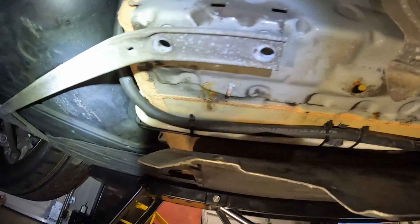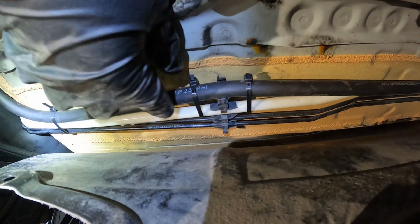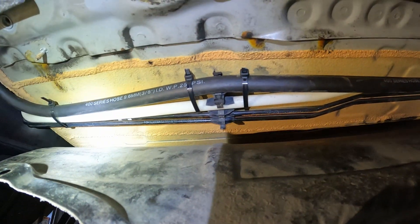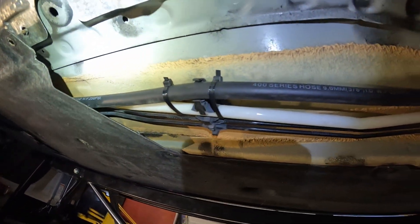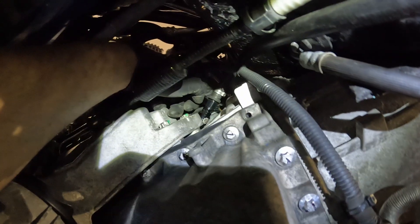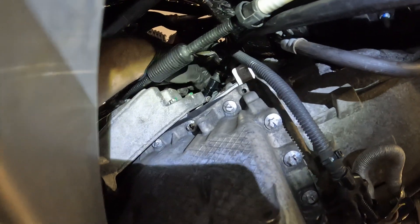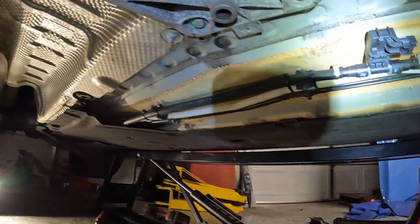I have it zip tied to the vent tube and brake lines, then routed down and under. I cut some of the plastic here where the existing fuel line goes, just to make room to tuck it up and in. I don't want it too tight because I don't want the plastic — which is meant for a much smaller tube — to possibly scratch it and eventually cut it. So routed it there, zip tied down. Further down here, same thing on that clip. Then the ethanol sensor — still want to see if I want to mount that somewhere more sturdy. It routes all the way up to the high pressure fuel pump. You would definitely need your intake manifold off to get to this line, so it'll be a little easier to get to once everything's off. You can also tighten it from down here, and then just have to route the wiring for the ethanol sensor and all the panels go back on.